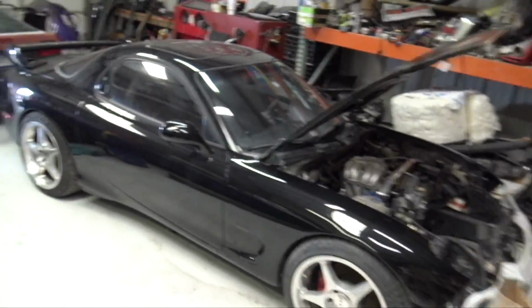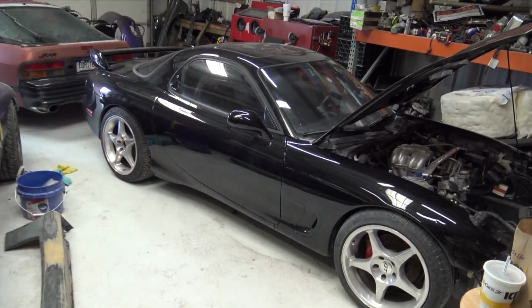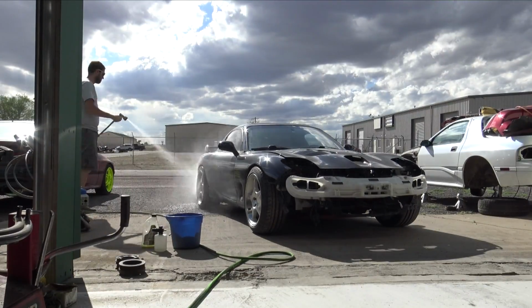I did a lot of R&D on it so I can get these flanges nice and ready to flow. So I don't have any issues with welding and then having to grind it down. I should just be able to weld all this stuff together, be 100% good to go. And when I weld it, I'll back purge it so everything will be nice and smooth. So let's get to work on this. Pull the FC out and then push the FD out and then wash her, go from there, push her back in, and then get to work on the turbo setup.